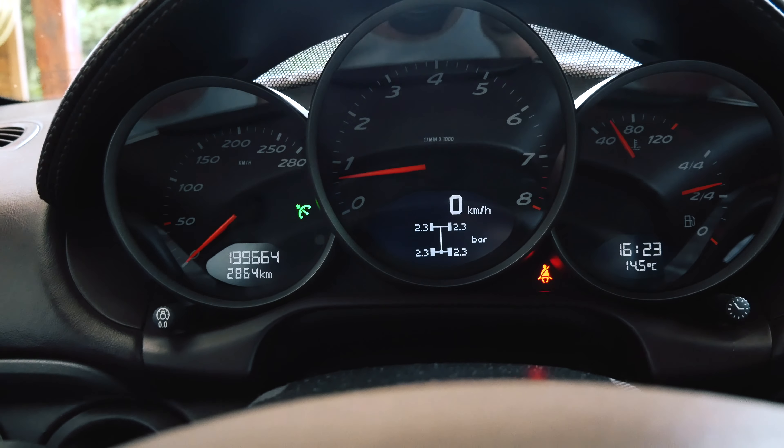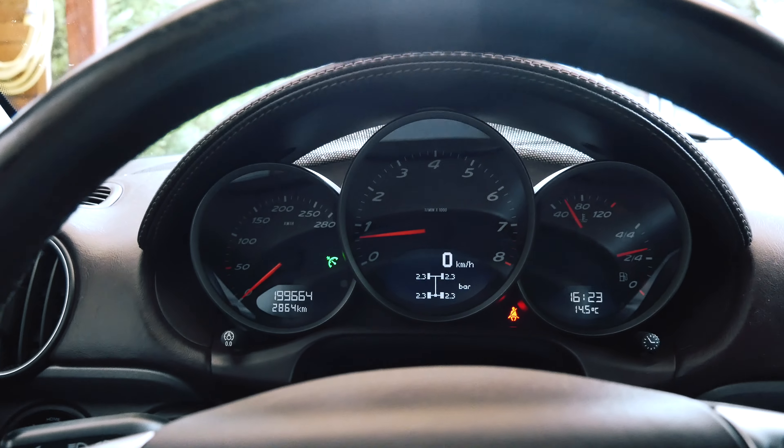I hope that this is going to fix my problem, because before it wouldn't hold a very slight incline or decline and the car would just reverse slowly — and it wouldn't pass the technical inspection. I really hope the car fixed itself, because it seems that everything's tight and the handbrake is tight and holds the car. Maybe you haven't learned anything from this video, but I just wanted to say that a few pull-ups with the handbrake can actually help and self-adjust the handbrake.